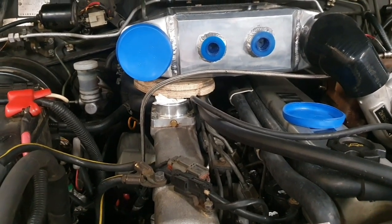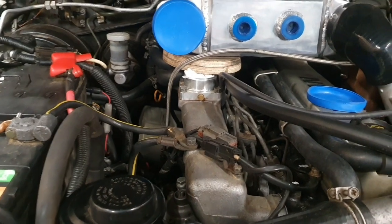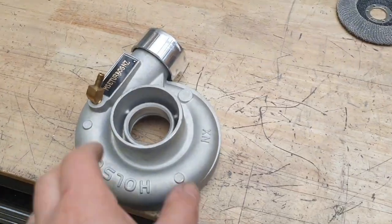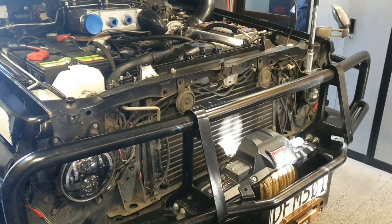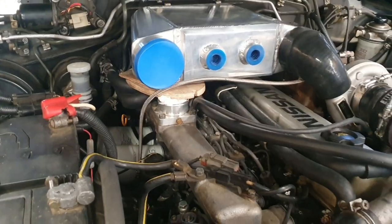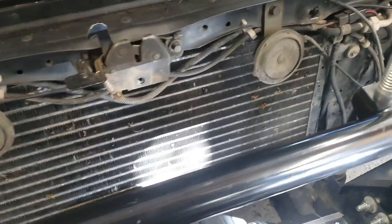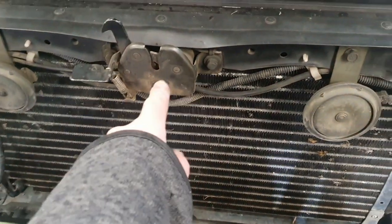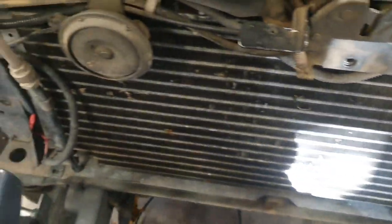We've got a Wiggins coupling on the way, and then we can start fiddling around once we know the height of that — chopping and changing and all that sort of carry on, which will be great fun. There we go — one lower profile outlet. I haven't welded that on yet; we'll weld it on the inside. So while we're waiting for our Wiggins clamp, coupling, flanges — the doofus between the blue bit and the grey bit — to come from Auckland, which is a bit over an hour and a half's drive and usually takes a day, we'll get on with putting the intercooler radiator in. Pulled the grill off, gives us decent amount of room. Took the brace for the hood latch out of the way because it just basically ruled out anything working at all. I'll replace that with some aluminium stuff.